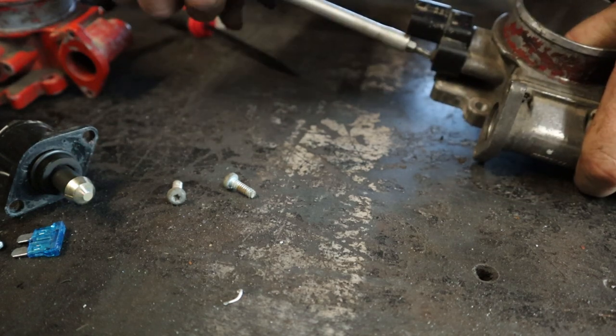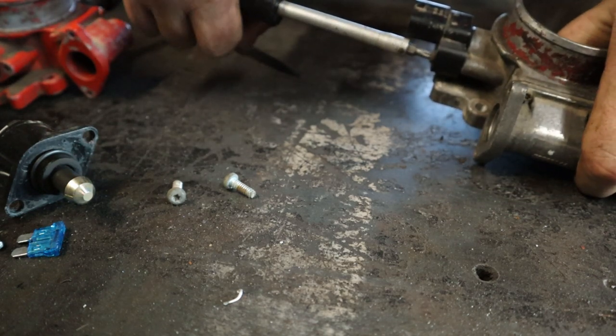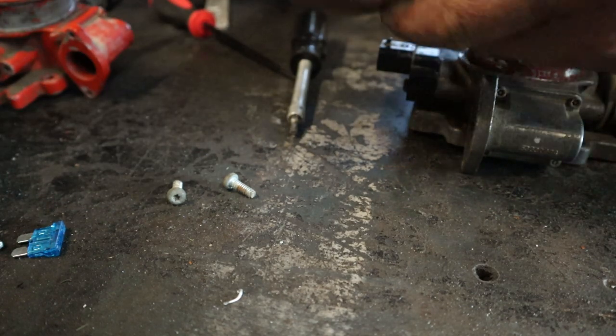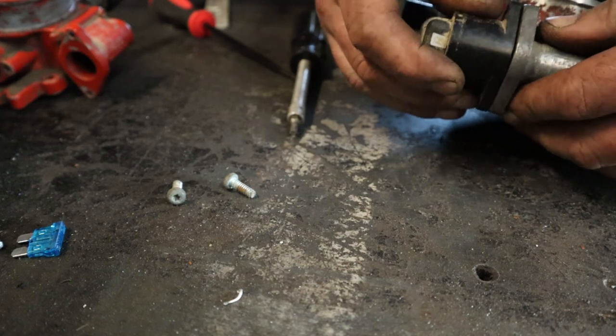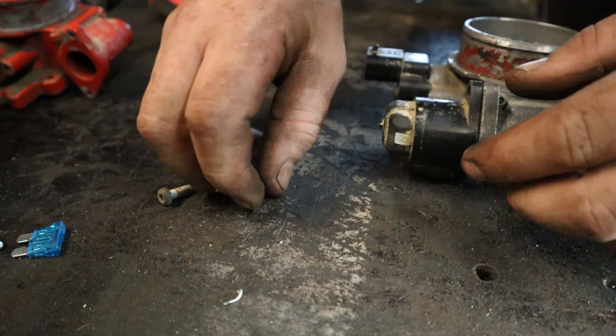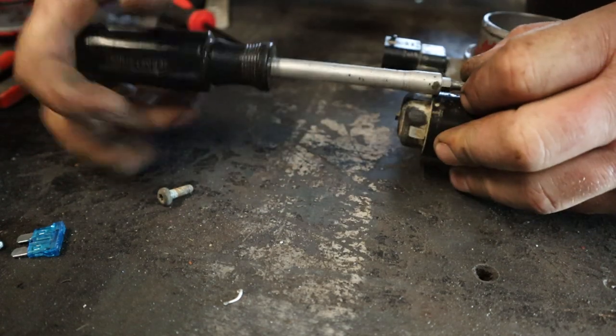You don't need to kill these bolts — just get them good and snug. You don't want to crack the plastic or strip the threads out in the aluminum. This one you kind of just twist it until you can feel that O-ring push in there. I had bought a new gasket last time and it tore taking it off, so we're just doing a cereal box cardboard gasket — it's gonna work.